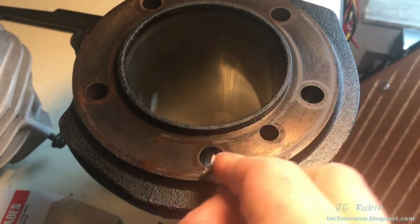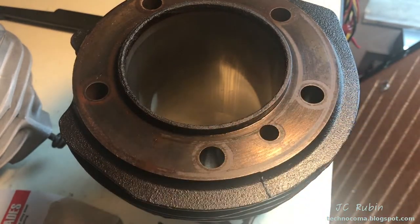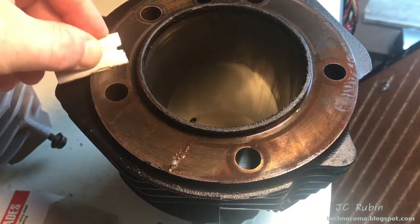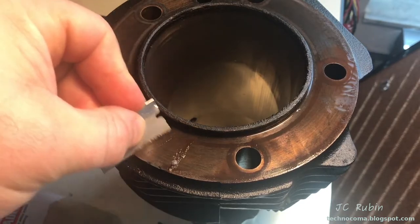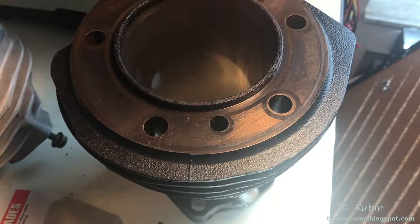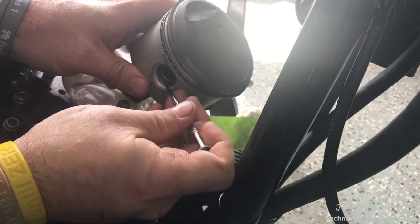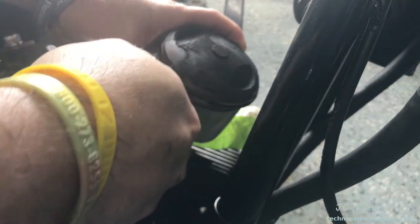After cleaning and oiling, this area leaves a silhouette you can see in the light, but it's perfectly flat — no dip, no rust — just a weird impression left in the metal. I'm going along with a brand new razor blade and it comes right up, just sort of discoloring the metal. There's no damage whatsoever. It's almost like a little plastic film lifting up, possibly mixed with extremely minor surface rust — just enough to leave the marking but without damaging the metal. Everybody says these wrist pin keepers are the best to use, but pray to god you never have to remove them — they're terrible. They're like the spring thing you put your keys on. As long as you understand they're not reusable, you can remove them.